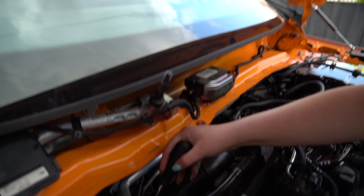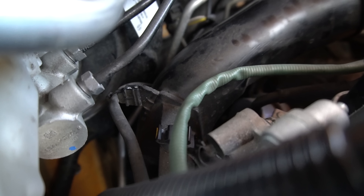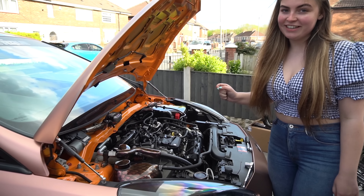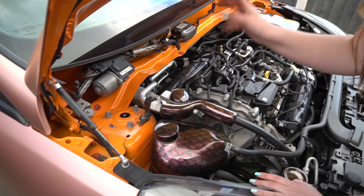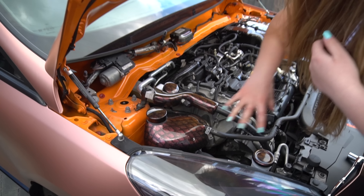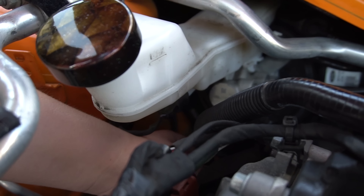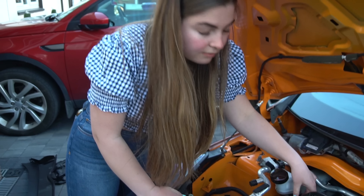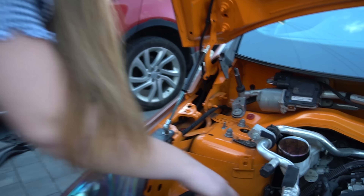This one as well — instead of pulling it towards you, you have to pull it towards the car. Once that one's off, it just pulls off like that. Use a flat head screwdriver to pry this part off. Then to get access further down, there's another one of those clips, but all of this is in the way — so I'm going to take all of this off, take the coolant off its hinges, place it down, and then we've got access. Follow this pipe to the end, there's a little sticky-out bit with a latch — twist it the only way it will go and pull, it should come off.